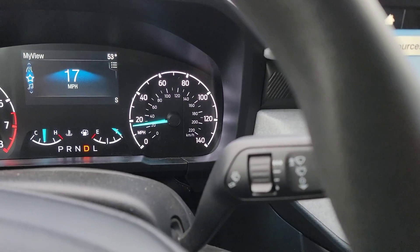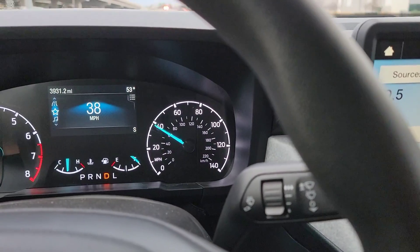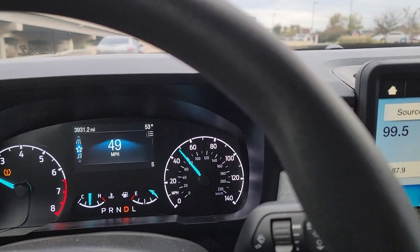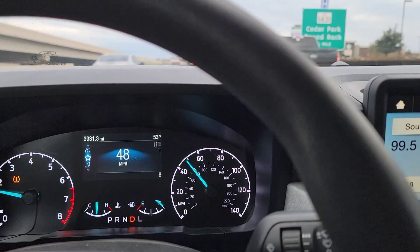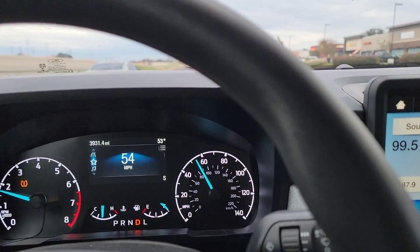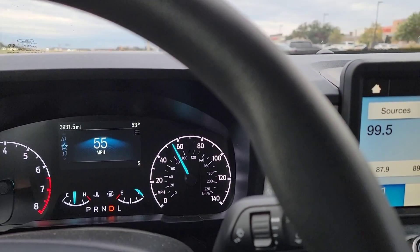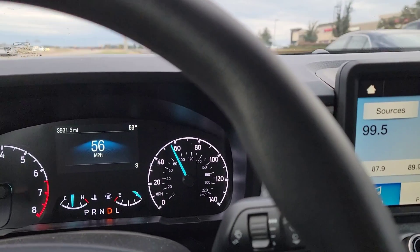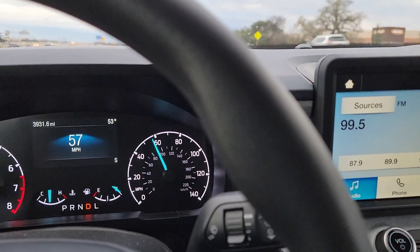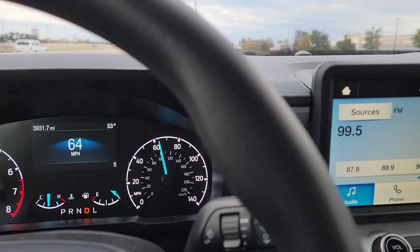So we've got ourselves a full tank of gas — three quarters of a tank of 93 octane, quarter tank of E-85. That should put it right at E-30, give or take. I did put a little more than four and a half gallons of E-85 in there, so the computer hopefully learns it. I am no expert. These are definitely not designed to be flex fuel vehicles, so I'm not going to be beating on it between here and the shop. I've got about a 20-minute drive, so I'm just going to cruise along, not get into the RPMs or anything crazy.